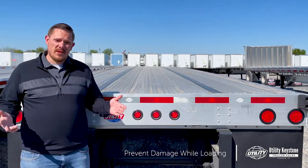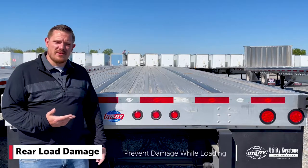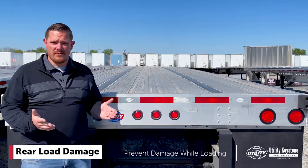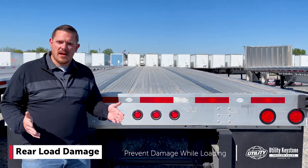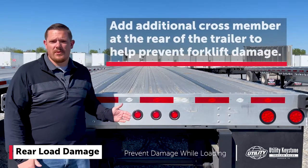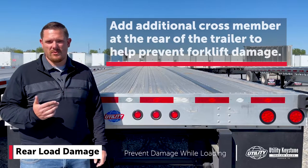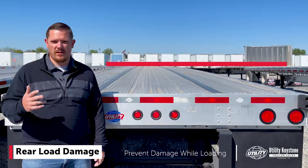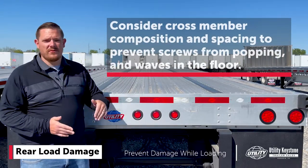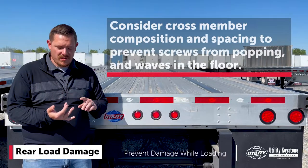But what if you're being rear loaded? There are some options to consider on that, as most flatbeds are not set up to back up to a dock and have a forklift come down and load you from the rear. Some of the recommendations we would make if you're doing that, first one would be an additional cross member at the rear. We typically recommend that on any flatbed just for some additional support back there towards the end of your trailer. In order to prevent screws popping or waves in your floor, we do have to look at cross member composition and spacing as well.